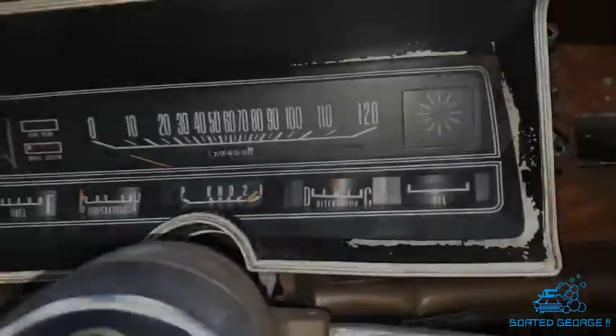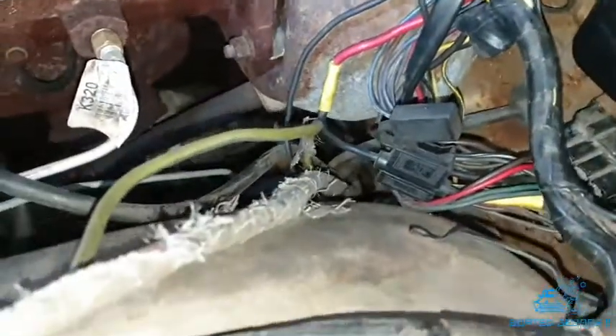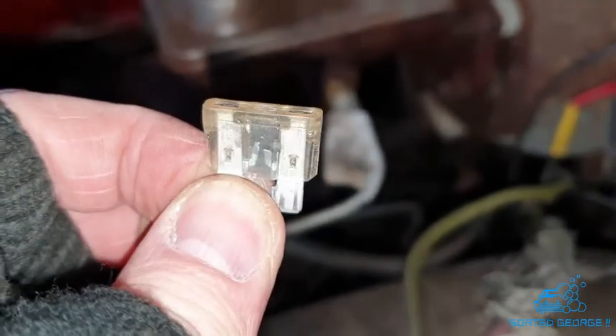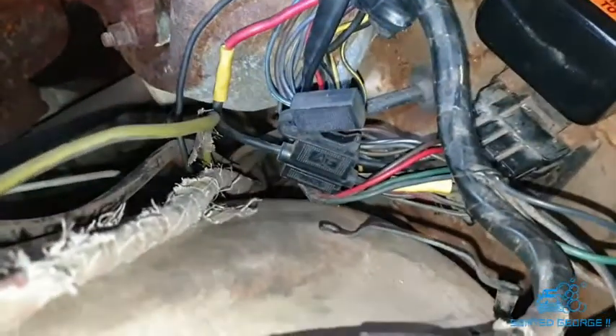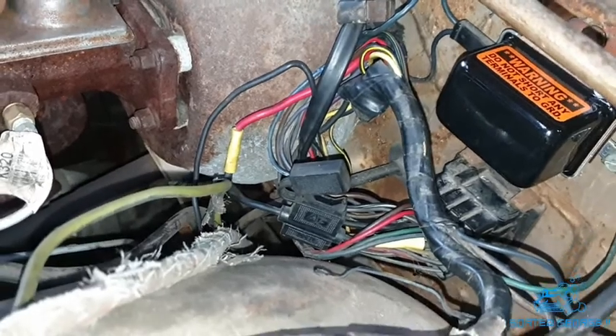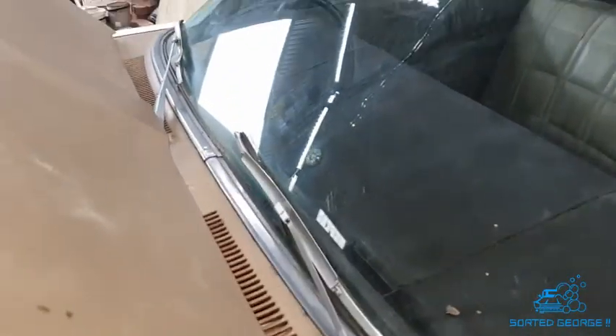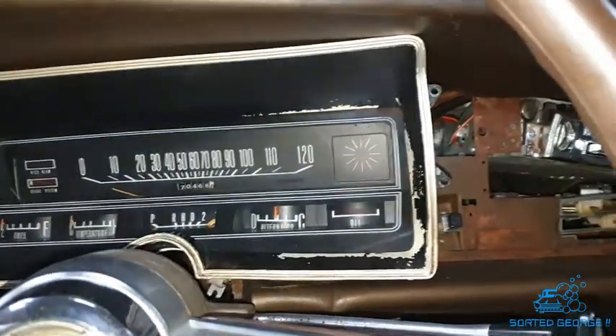Sorted. After much mucking around up under the bonnet, we have a fusible link and a blown 25 amp fuse. So that's what it is. Just got to work out the cause — whether the wiper switch is completely dead or not, I don't know. By putting it back on I did have power there. Maybe I just touched something underneath. My fault. Oh well, a new fuse — sorted.